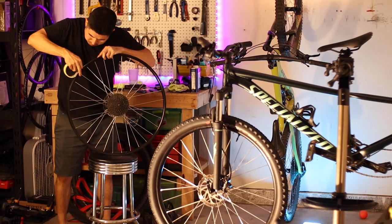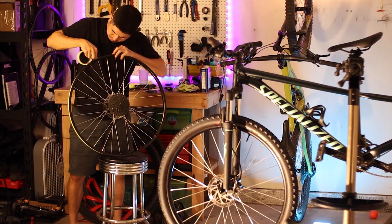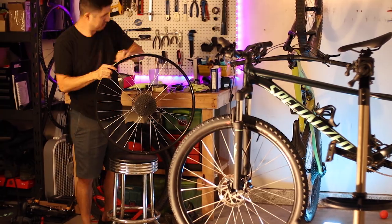The rim only needs to create an airtight seal at the bead interface and seal up any spoke and valve holes at the same time. If your rim isn't tubeless ready, it can pretty easily be converted to tubeless by taping up all the spoke holes and the valve holes with a single continuous adhesive tape liner. This liner is called tubeless tape, and many brands offer their own version.